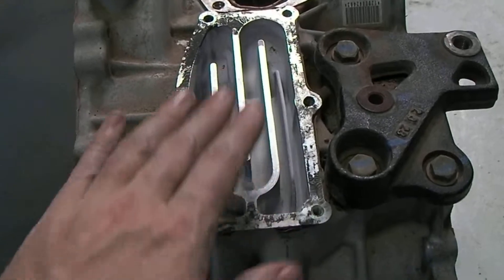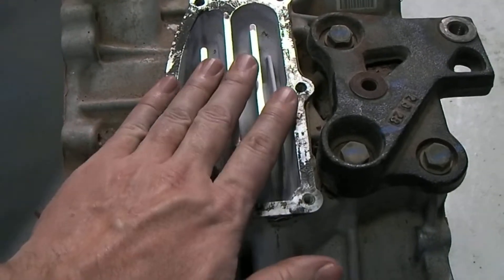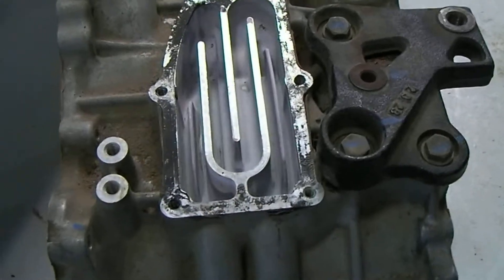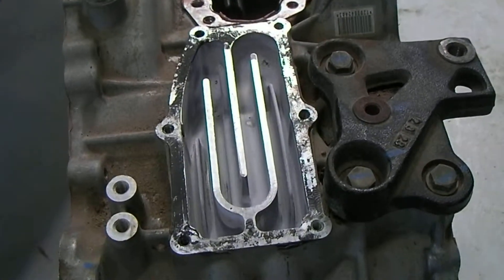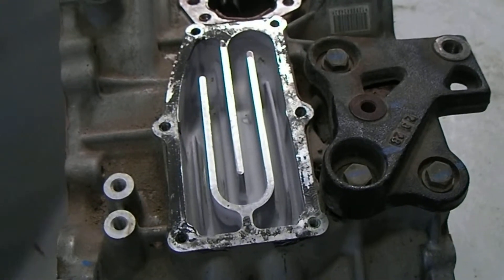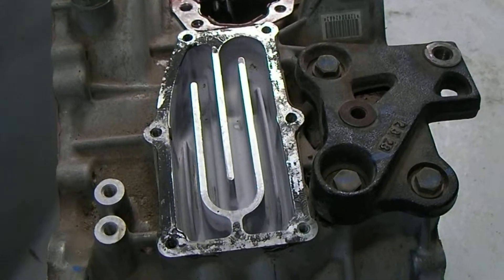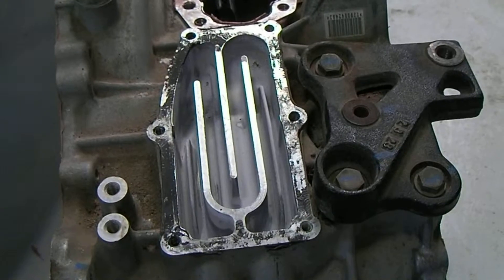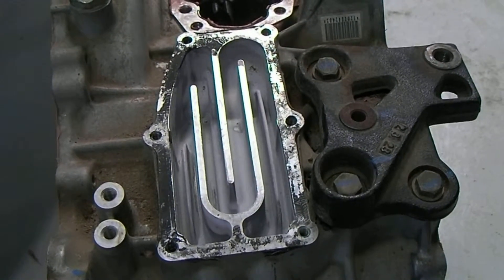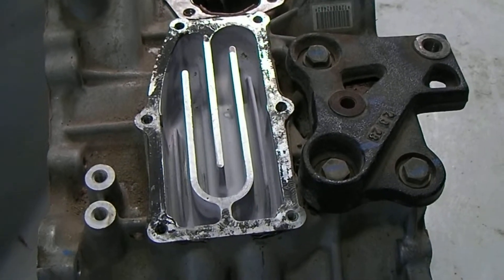Very simple — there's nothing to it. Just flow coolant through there. The heat that comes up into these fins is drawn out by the coolant and it's pumped out to a separate radiator that is made just for the inverter and the motor generators on the Prius. And it helps keep MG2 cool. When electronic components are kept cool, obviously they are much more effective in the way they work.